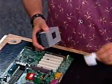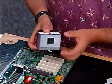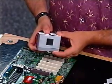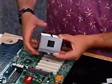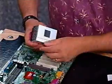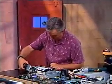Notice this one has a little sticker on it that reveals some nice thermal material. This is going to make sure we have good contact with the processor, and because the processor is directly in contact with the sink, heat is drawn right into that heat sink. Now notice there's a lip on this fan — that lip has to go right on the lip on the socket. I'm going to now angle it in.